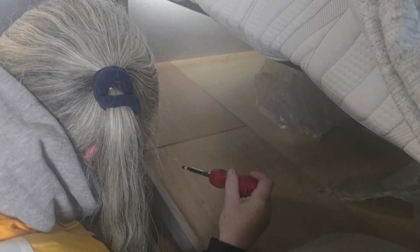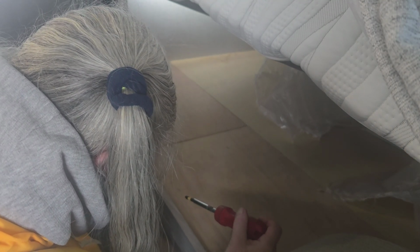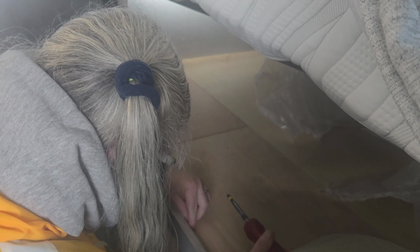All right, so you got 2 screws. You got one right here. Let me get this in. All right. Okay. And then I'll show you when I get this open. There is a tag down inside here, which will show you which way the valves have to face. Your valves on any camper, doesn't matter what brand, if it's a Suburban hot water heater, or if it's the Dometic like this, wherever those valves are, when they face the hot water heater, that's where it's going to be in the off position.